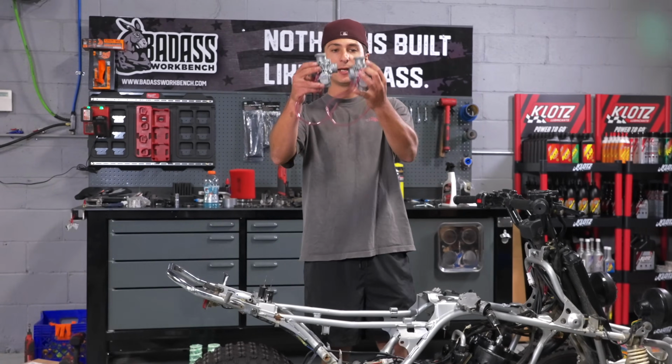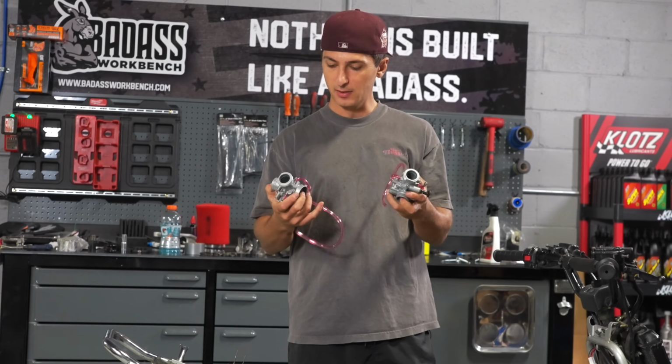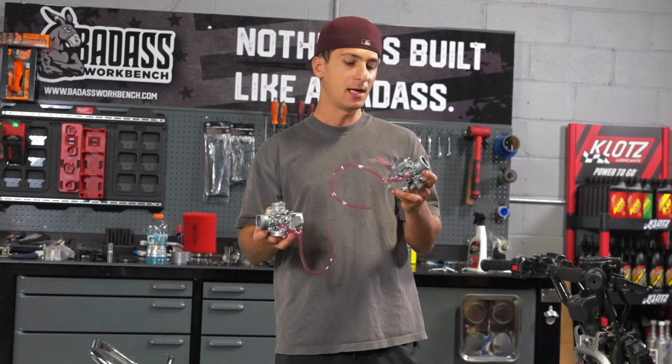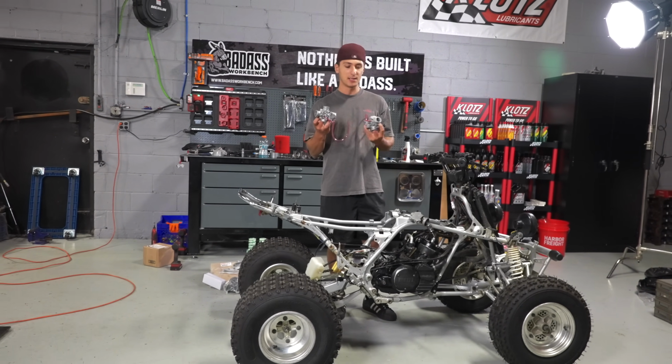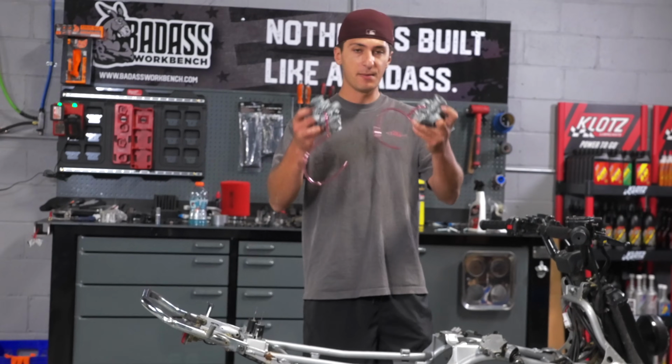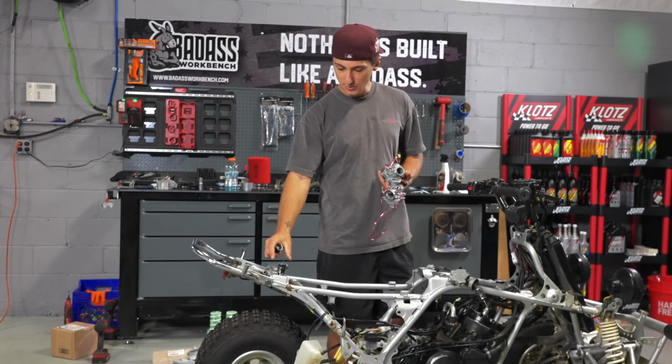I also went ahead and rebuilt the carburetors. They were honestly really clean, but the jetting was definitely a little off. They had really big pilot jets. He had 32.5 in there. I dropped it down to a 27.5. We got 280 mains and they're vapor honed with some fresh carb lines. I found slides that already had the 2 needles in them, so we're gonna swap that out.